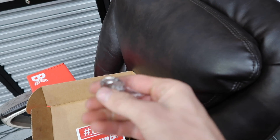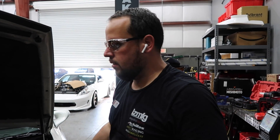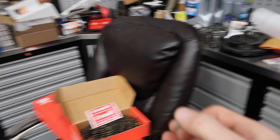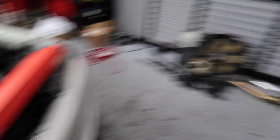Alberto, do you know the purpose of titanium retainers? Just lightweight. The springs are about 20 pounds stiffer than stock since the cams have bigger lobes. The titanium retainers are lighter for revs — less weight pushing on the spring. Me and Luke are trying to go to the track for some last-minute testing before this big trip. So Alberto is going to take over and film putting the 264 cams in. We can always lean it out and get some lean lope — though that's probably not good.